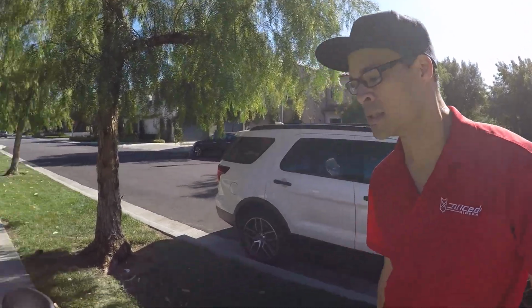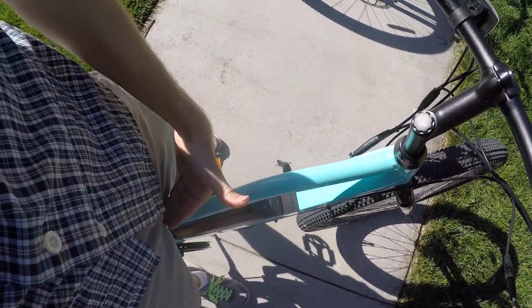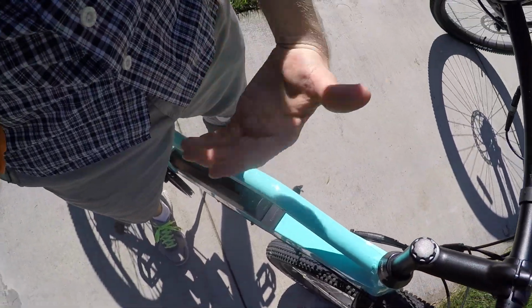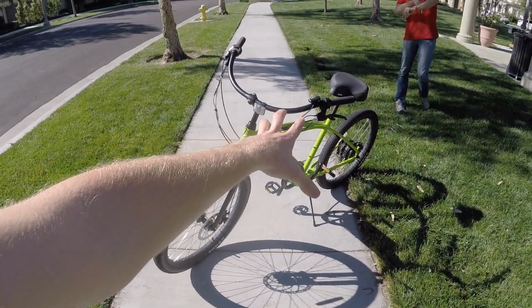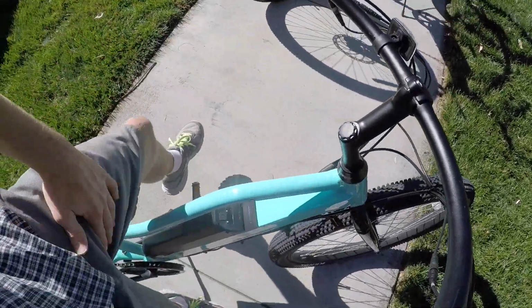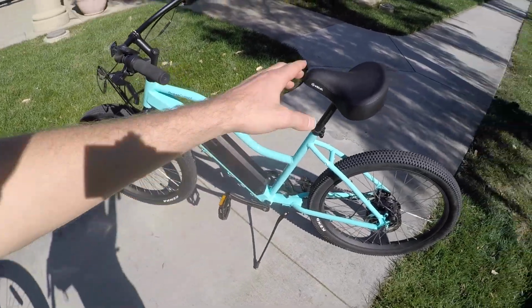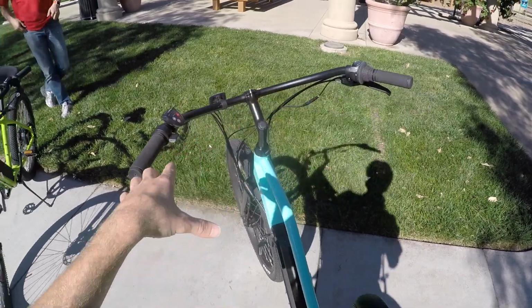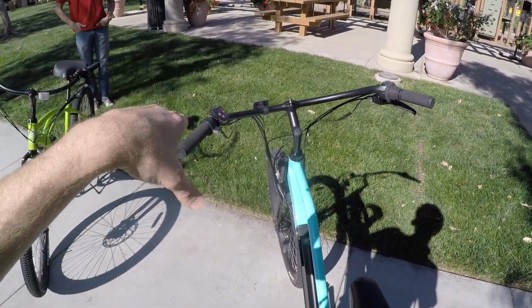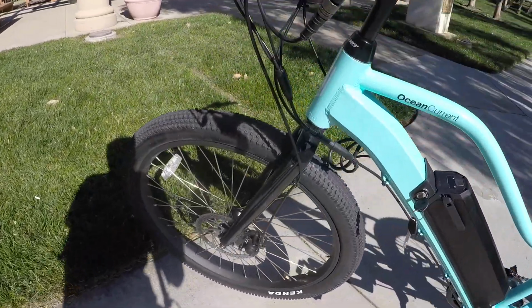That's by design. Well, back at the website, I've measured standover height, and that's this measurement. Hopping on the frame, how much clearance do you have? I have female friends who ride bikes with me sometimes, and they're a little intimidated with the higher step because you jump off and you can hit your leg. Both of these are about 18 inches. And there's a lot of adjustability in the seat post and these big swept-back handlebars. Tora was telling me this is custom, that they chose one themselves that really seemed to fit and feel good on this bike. Aluminum alloy, rigid aluminum alloy fork.